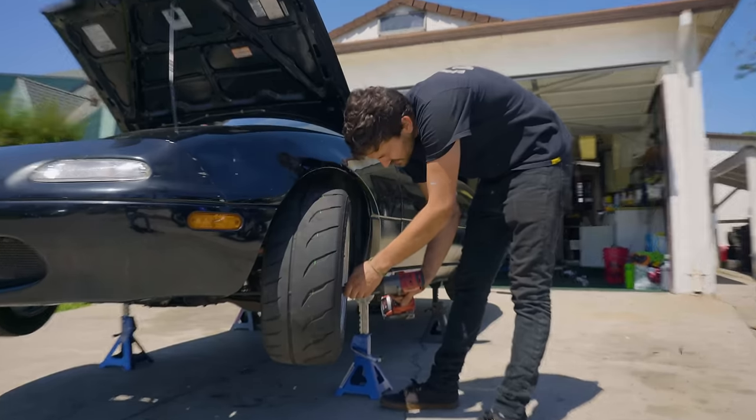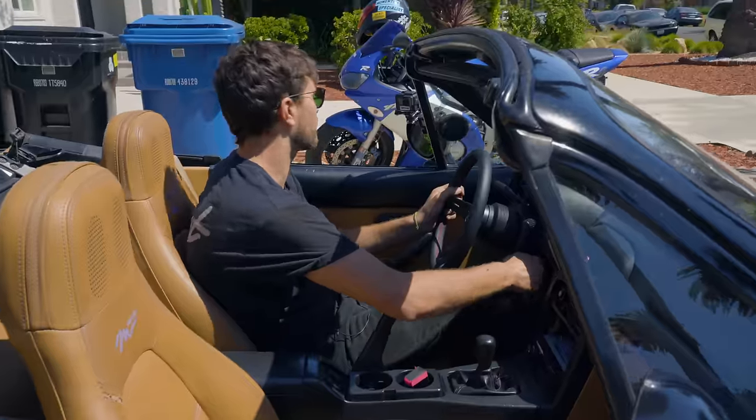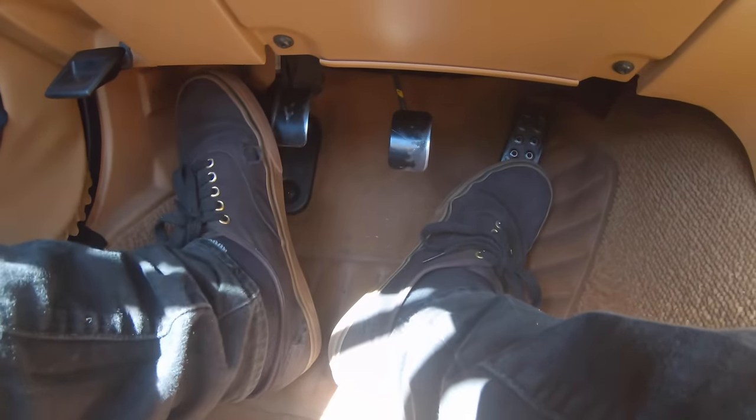The interior's finished, the exterior's good to go — time to put this thing on the ground and go drive, see what this thing feels like, finally. Okay, just trying to take off as smoothly as possible. You can definitely tell that it's a much more aggressively engaging clutch, and the engagement window is a lot smaller. It goes from being completely disengaged, you feel it start to engage, and then it's engaged. But it's not that bad. It's pretty dang drivable, really. I was a little bit concerned going into this that we were actually gonna really wreck the way this thing drove as far as being easy to just hop in and go for a cruise. The clutch pedal is a little bit heavier, the engagement is a little bit harsher and more aggressive, and the engagement window is a little bit shorter. But it's not that bad, and we've got more torque holding capability out of it.